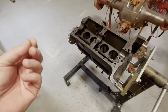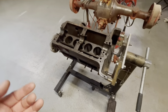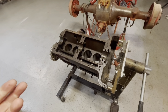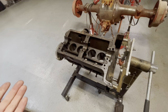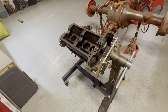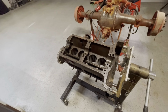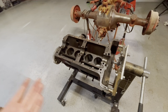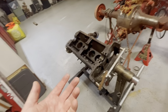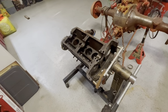I still got Ford stamp valves in it, so I think the valves are original. But somebody was in the bottom end — the main bolts, my half-inch DeWalt 20-volt impact wouldn't undo them and I had to use a breaker bar. They say it's 1,200 foot-pounds but realistically it's probably 600. So I think they're over-tightened, but I think the bigger problem was an oiling issue. From what I'm reading, these do have a pickup issue on the oil feed, so I need to make sure that's all good when it goes back together.